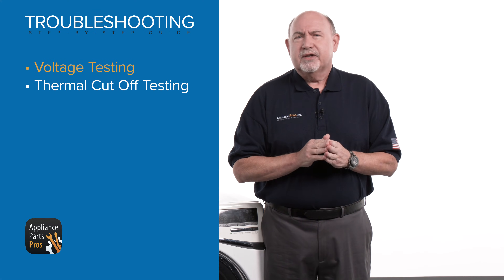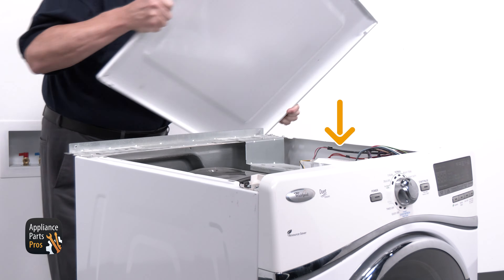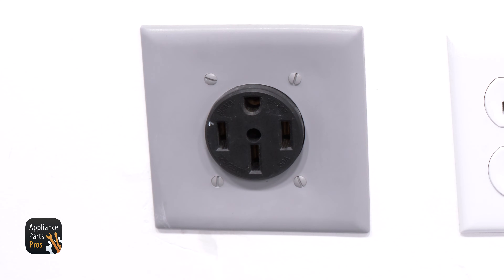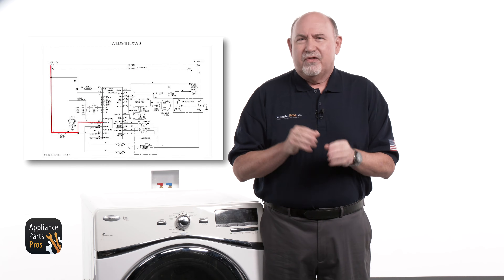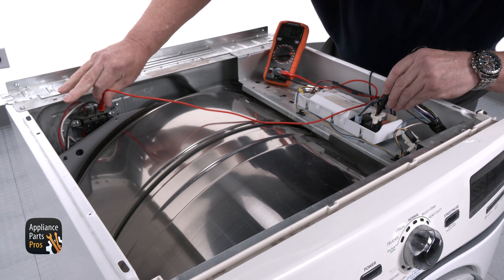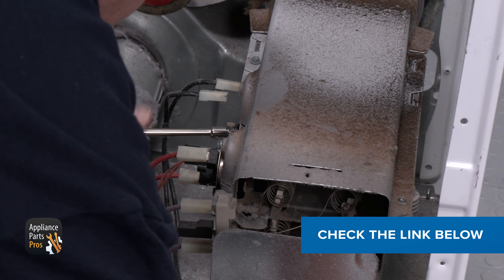The rest of our tests involve the main control. To access it, remove the two screws in the back of the top panel and slide the top off. You'll see the main control laying on the right side. With the dryer unplugged or the breaker turned off, set your multimeter to continuity, which looks like a sideways Wi-Fi symbol. Then touch one probe to the black wire at the terminal block and the other probe at the black wire connector going to heater relay 1. If you have continuity, then the high limit fuse at the heater box is good. If there's no continuity, then the high limit is open and the high limit kit, which consists of two parts, will need to be replaced. I've included a link so you can see how to check and replace the high limit kit.